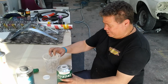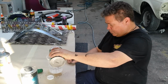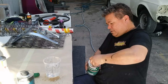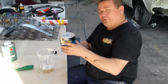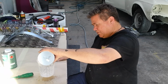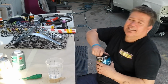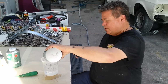So I'm going to mix 700 mils of my thinner into a cup and spill half of it all over the table. Just use a basic paint mixing cup. 700 mils. And I'm going to put 300 mils of xylene in there. So about 30%. It makes about 900. Let's live life on the edge. We'll put a little bit more in. You notice I'm not even being all that accurate.